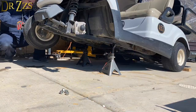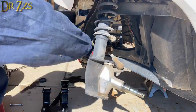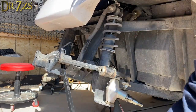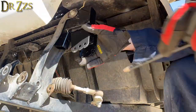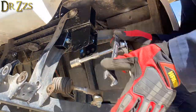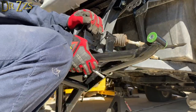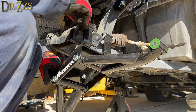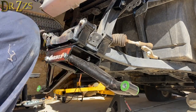To start with, I put a big lift kit on it. If I had to do it over again, I might not go quite so high because, as you'll see later, it gets a little unstable. This particular lift kit requires you to replace the A-arms, which was kind of a pain to take off. There are some that do the lift differently and don't require the A-arms to come off or drilling into the frame. But I'm actually pretty happy with the one I got. The other style uses elongated spindles instead of new A-arms. This one was more expensive, so I'm going to tell myself it's better. It looks pretty good and it's got a picture of a rhinoceros on it — so how can you not love that?